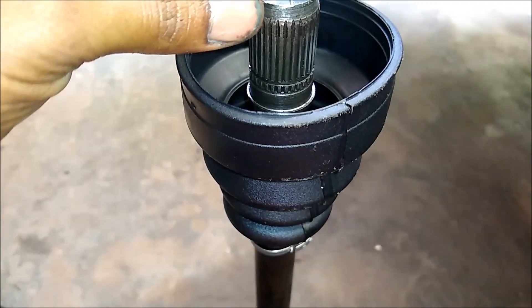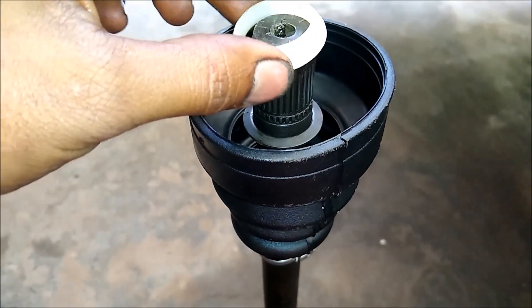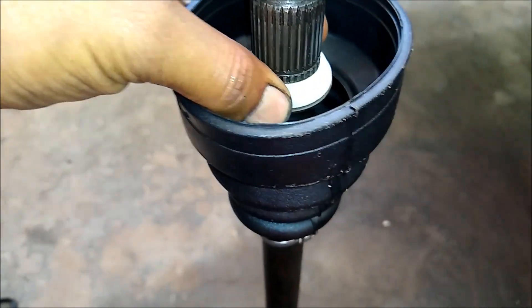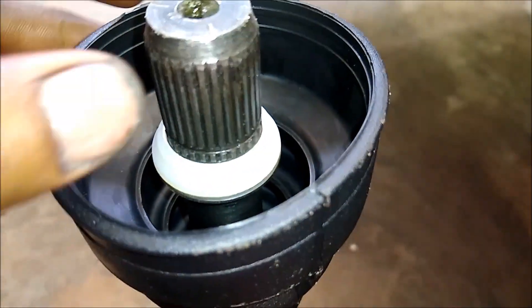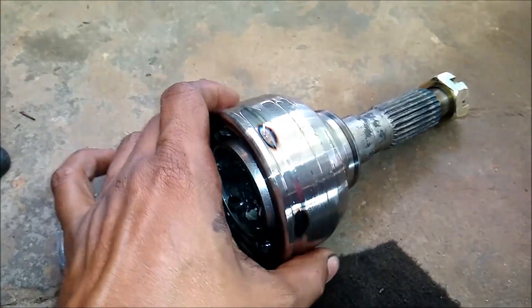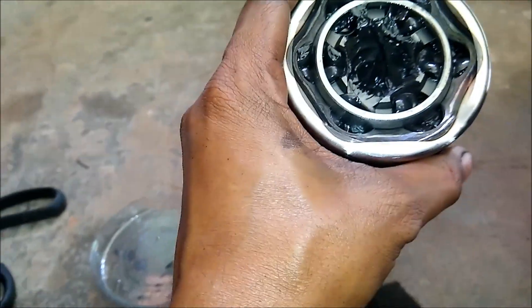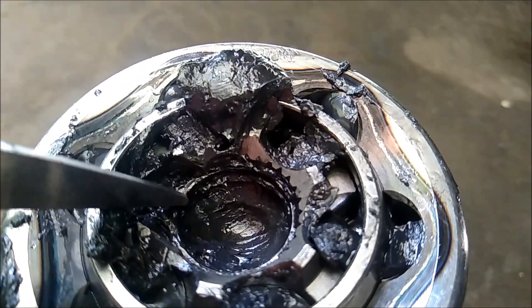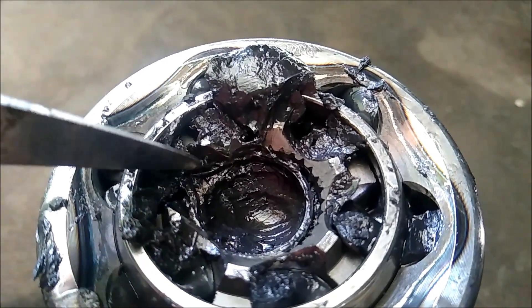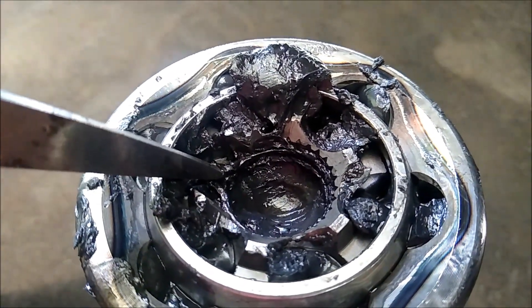Now let's put this washer — there. Washer right here. This other plastic piece right here. You can see the snap ring groove there. Look at this — the homokinetic joint. Interesting: it comes with a cap here and already has grease inside. But it was missing the snap ring — can you see? It was missing the snap ring here. Look — the snap ring is here inside now, just installed. Can you see it moving? So now just take the shaft and insert it here, and it will automatically lock the homokinetic joint.